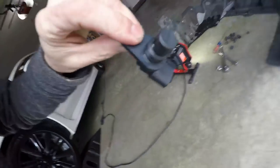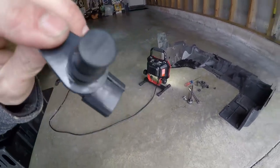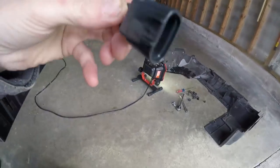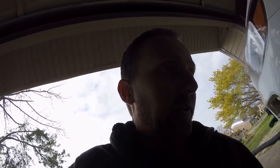You don't always win them, you don't always get it right. In this case I got it wrong — put in a bigger o-ring, too big an o-ring. I definitely don't think I'm going to spray it out. Let's take a look at the sensor real quick. I do not think for one second that the sensor itself is leaking — it's almost impossible. It is sealed; there is no way that oil is getting through the sensor. It's a solid block, so it's the o-ring issue, that's what it is. I'm going to have to order factory o-rings. I got all these o-ring boxes from all these fancy places, and maybe they just don't work well and you do need the factory o-ring.